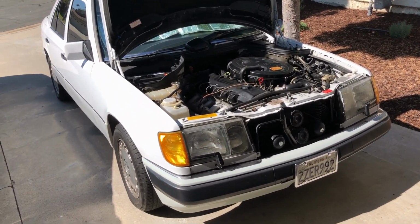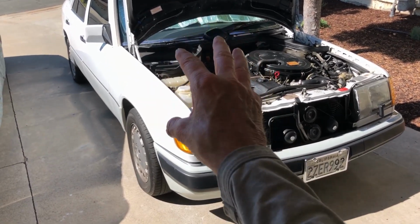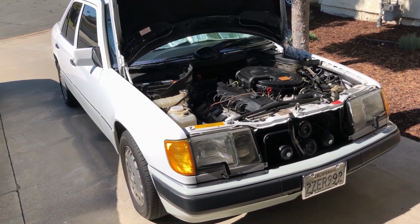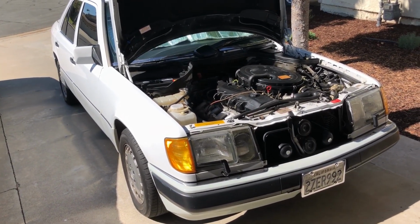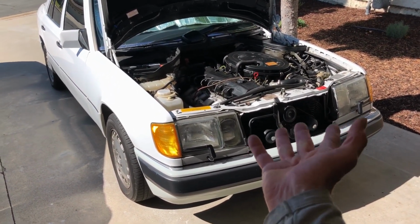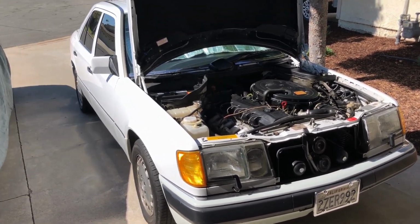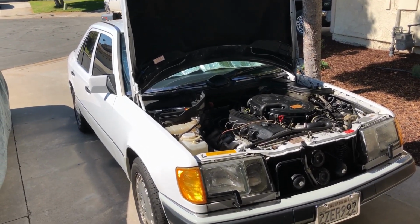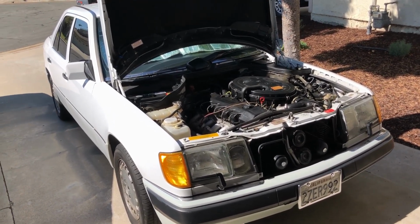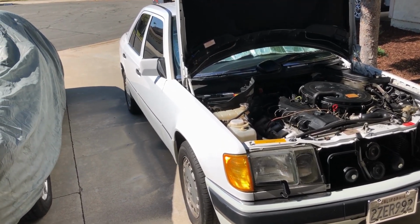What I think happened with this car, with the head gaskets blowing, is these engines don't like getting overheated. They're known to blow head gaskets when they overheat. And that high-speed fan function has never worked in the 12 years plus we've owned the car. So that explains a whole lot. Now we need to find that person that did the switcheroo on those pins. I mean, come on.